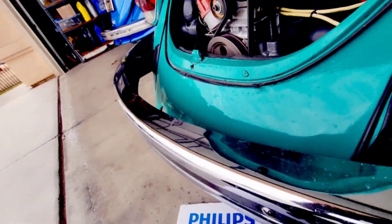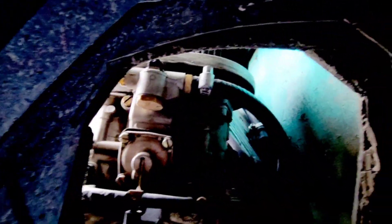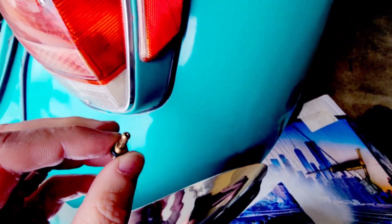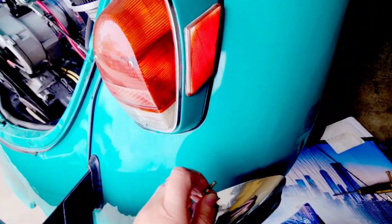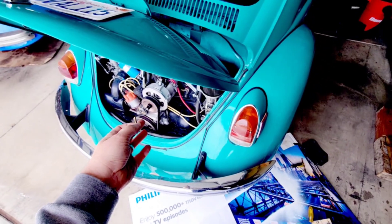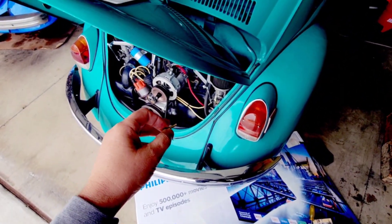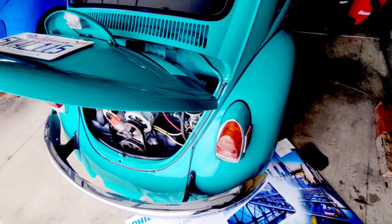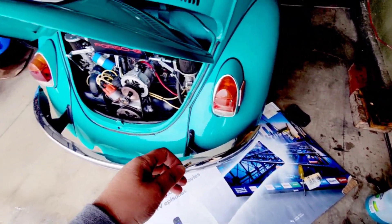I'm gonna put in a little vacuum brake bleeder so we can suck all the fuel from there. We're gonna remove the idle jet down here - there's no room. I took the idle jet off and I don't see anything in there, so the debris has to be in the circuit. That's why I use the brake bleeder - it sucks all the fuel out. I have an oil extractor - hook up the compressor to it and it just sucks everything out of the carburetor. But I'm just gonna keep it simple and grab the brake bleeder.